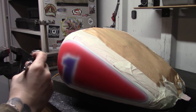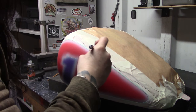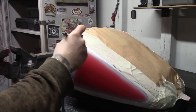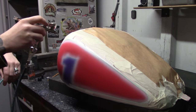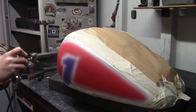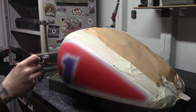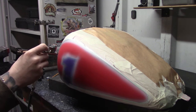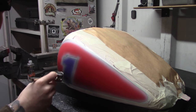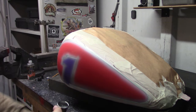So we finished the last episode of me applying the silver pigment over the white base I've created before. What I didn't show on the camera is later on, when this is dry, I'm applying a fine line masking tape right on the silver to create an edging, basically a fine pinstripe with an airbrush of silver to bridge the red and later on the black, because we're gonna apply black next.